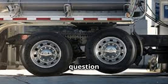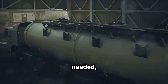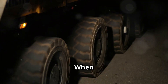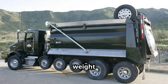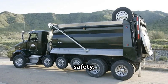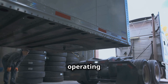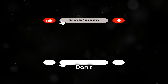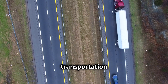So, the answer to the video's question is that some trucks have lift axles. These axles can be lifted when not needed, making the truck more fuel efficient and reducing tire wear. When the truck needs to carry a heavier weight, the axles can be lowered to legally carry a higher gross weight and comply with regulations, while also improving grip on the road and increasing safety. An additional lift axle can be a very useful tool for trucks operating with variable loads. Don't forget to subscribe to our channel to discover more amazing content about the world of engines and the transportation industry.